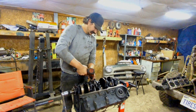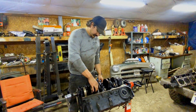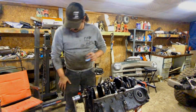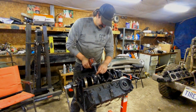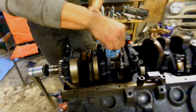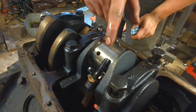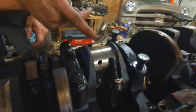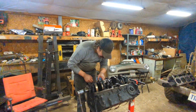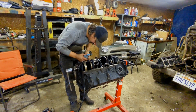This one has no bearing in it because I already pulled it — it was shot. If I remember correctly, the crank is also shot. Come look at this — it's hard to see but there is a lip right in the middle where it steps up, because this side of the crank is hammered down. My fingernail is catching it. So this crank is no good. The rods might actually be okay — oh no, that rod looks like it got beat up.